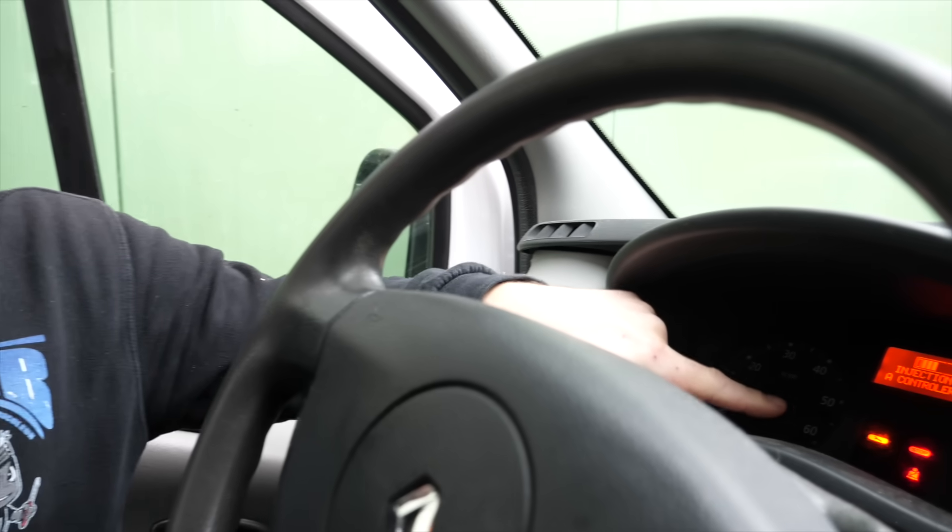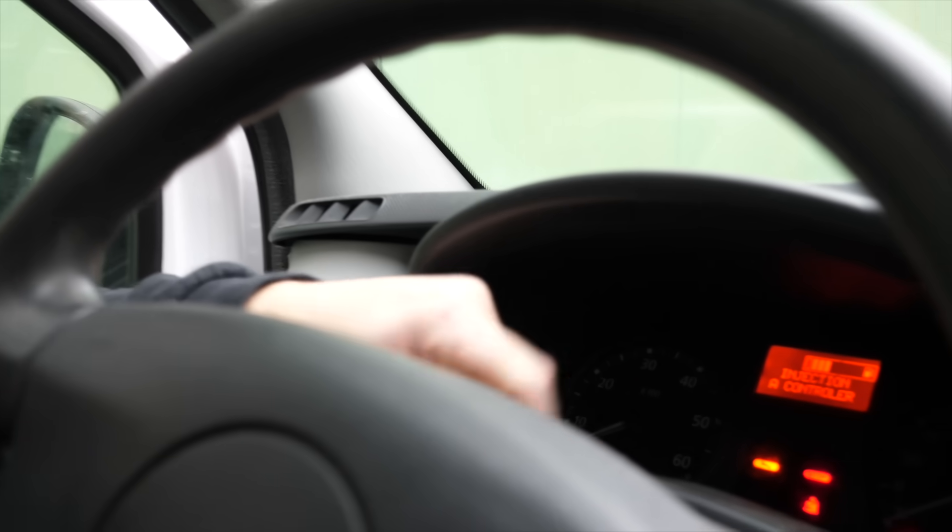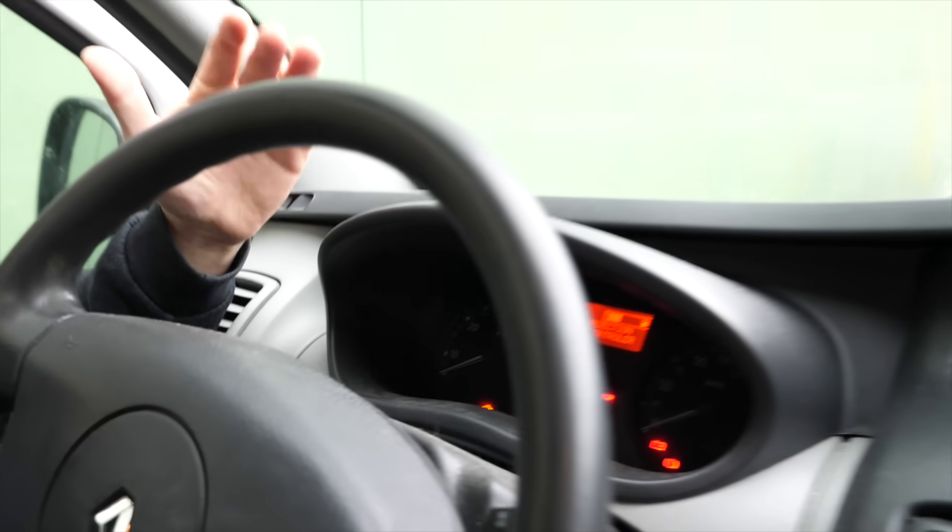Friends, we are here for a new video. I hope you are well. This traffic van is not doing well. You see, there are two — even three — warning lights: the engine light, the key warning, and the motor stop with injection control. The vehicle's condition degraded when I tested it. I have a problem with pressure, with the turbo, and above all a problem of clogging of the particle filter.